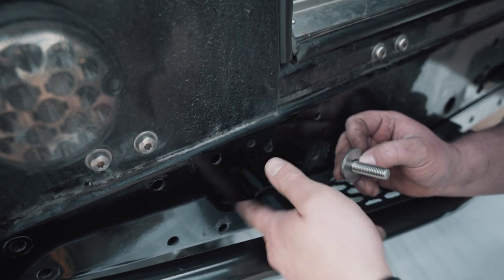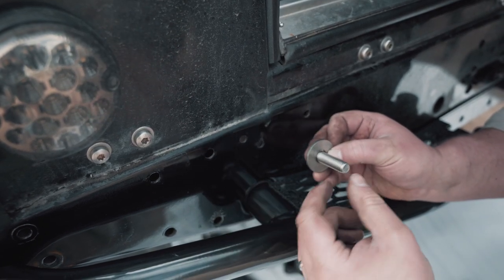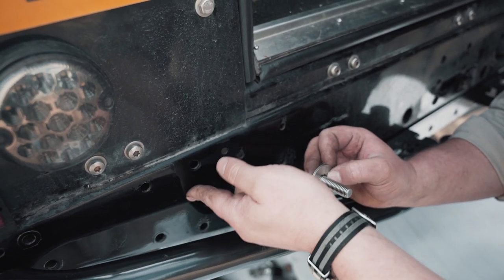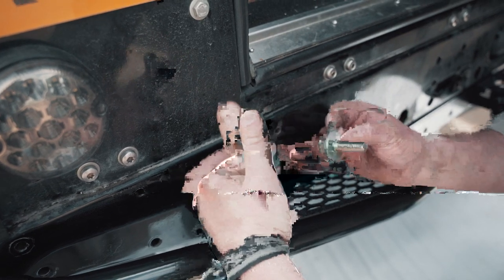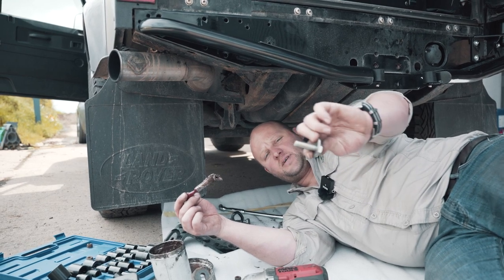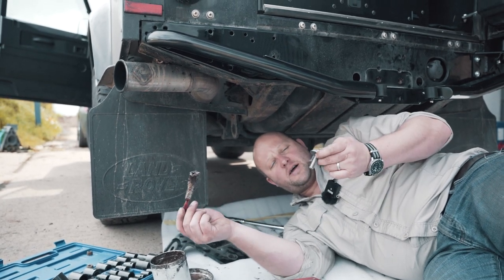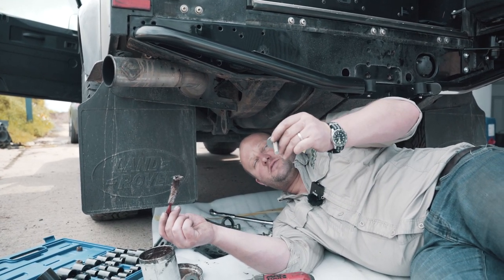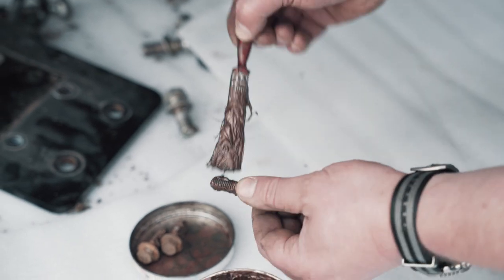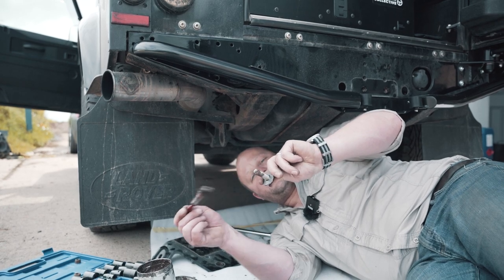Now that the three bolts are in down there, before we tighten them right up, the tubes are in here on the back, so we're going to bolt these into the end of the tube stay. Gently pull this up against the crossmember and make sure both sides are even, because in the manufacturing process of chassis the welding can cause a bit of distortion and they can be slightly bowed. Stainless has a nasty habit of binding — so I always put some copper slip there. There are proper stainless anti-seize products, but this is going into mild steel so copper slip will make sure it doesn't bind up, and if you need to take it out it should come out nice and easy.